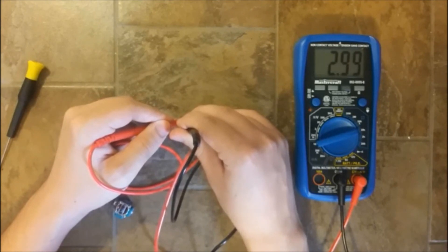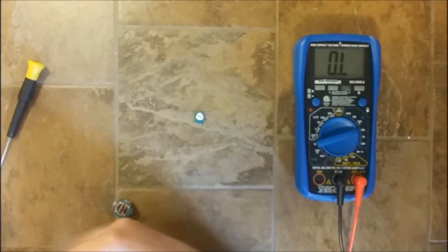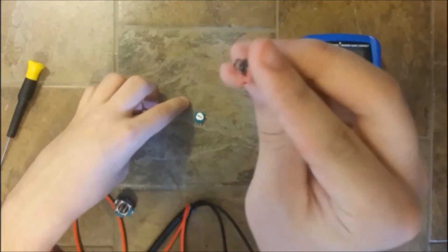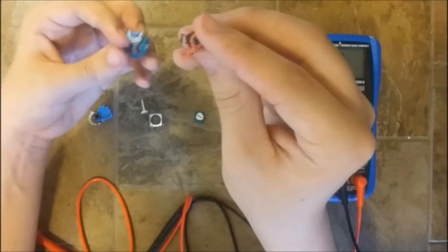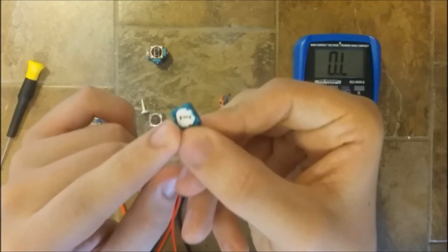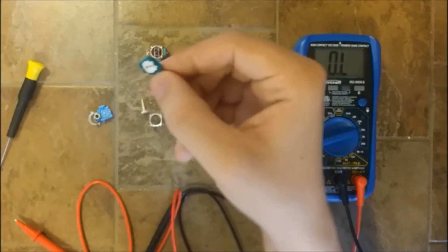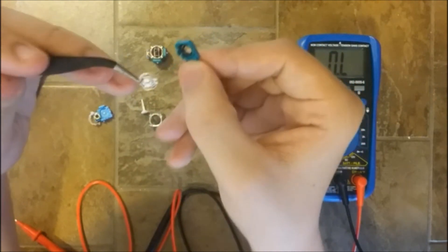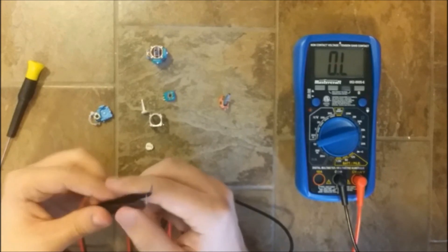This is basically how your controller knows which direction the joystick is going. Usually when there is drift, it's either the little spring we saw earlier becoming too weak to center your joystick properly — in that case it's better to replace the old analog stick module for a new one like this — or sometimes it's because dust or corrosion gets onto the potentiometer traces inside. This is basically what can cause a fault. I hope you enjoyed this new style of video — comment below if you liked it, and have a nice day.